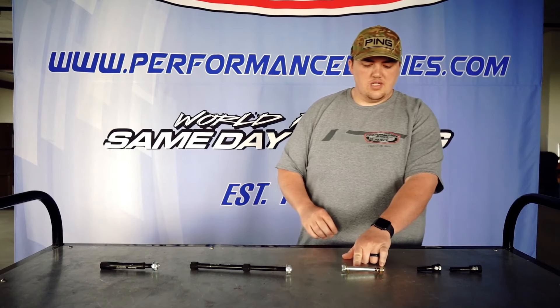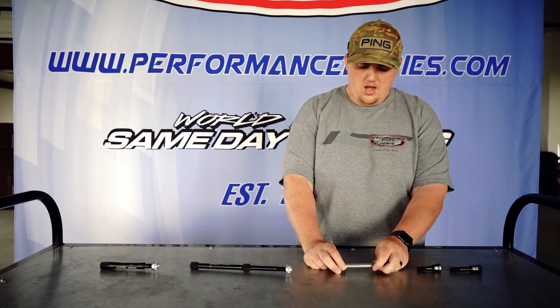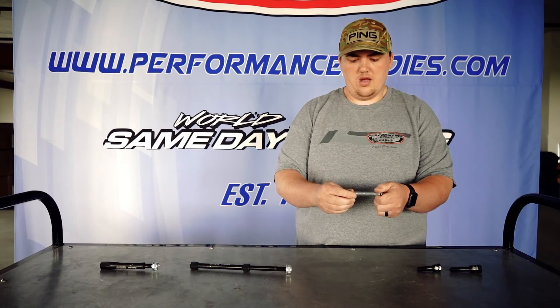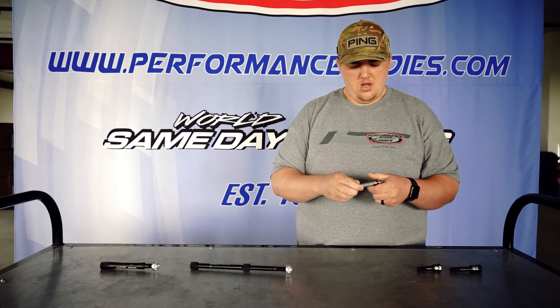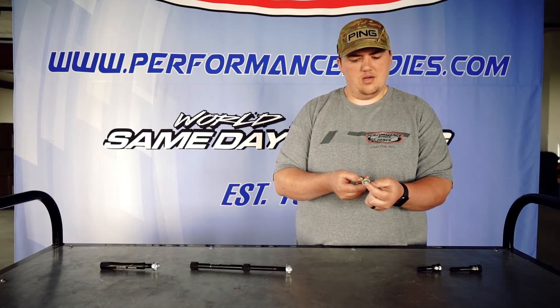This one here is a lower control arm bolt. It comes for a metric or Chevelle style front end. It has a nice smooth surface for the lower to ride on, rather than a rougher thread style. It also comes with this point — a good centerline measuring point for your ride heights and whatnot.